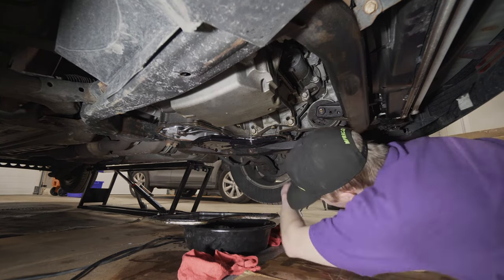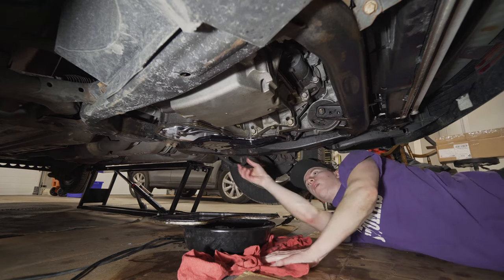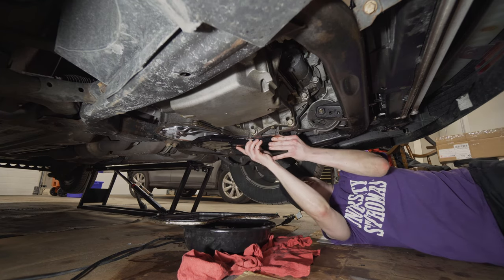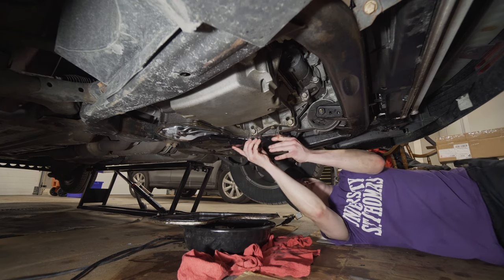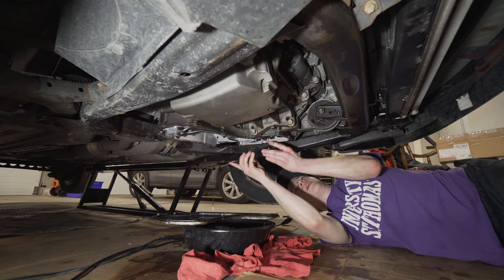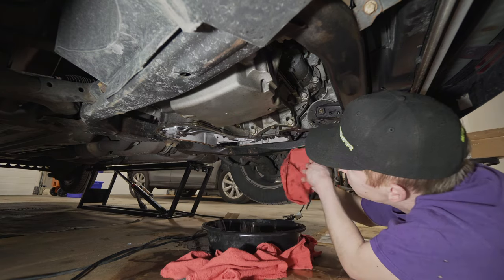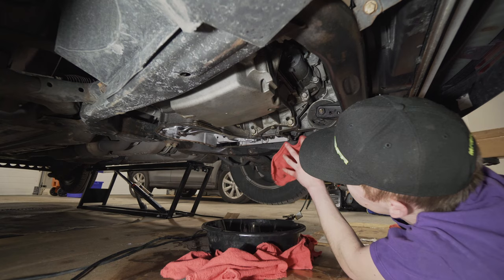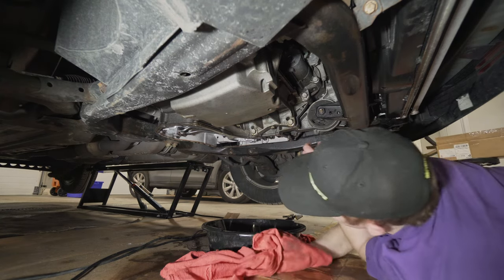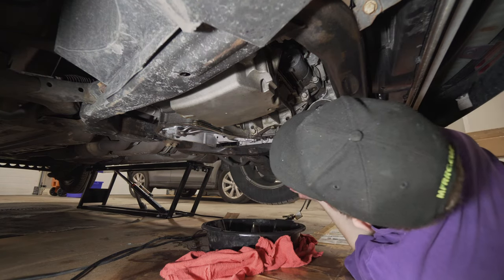So now this exposed our filter, which is just a pressure fit in the front here. The new filter comes with a little fresh sleeve, but we are going to skip that because it is really difficult to pull out. Just going to try to clean up this mating surface. The kit also comes with a fresh gasket. So we'll put our fresh filter back up in here.